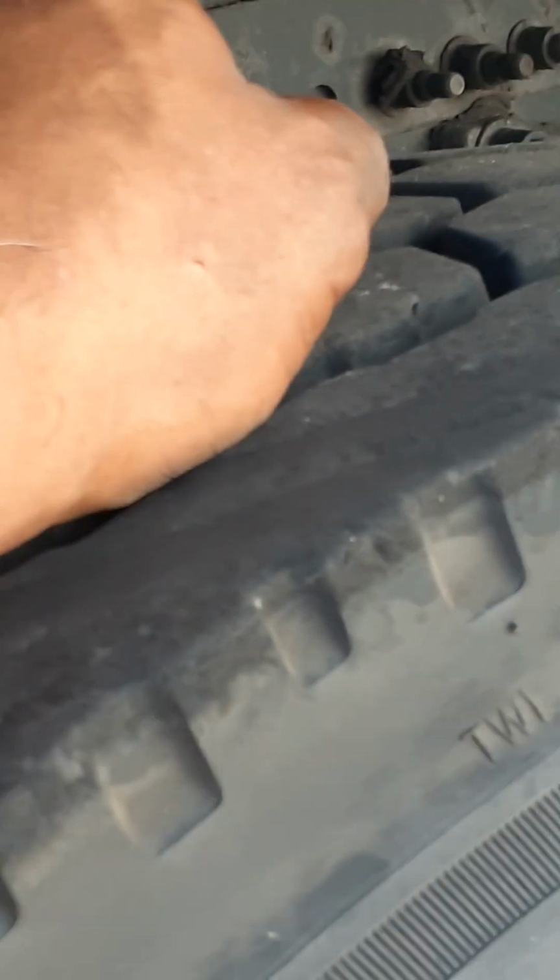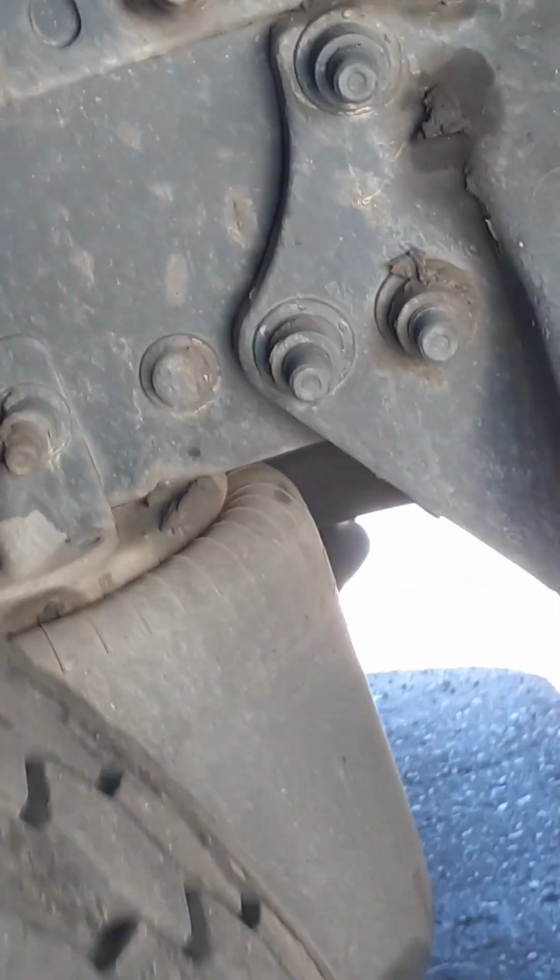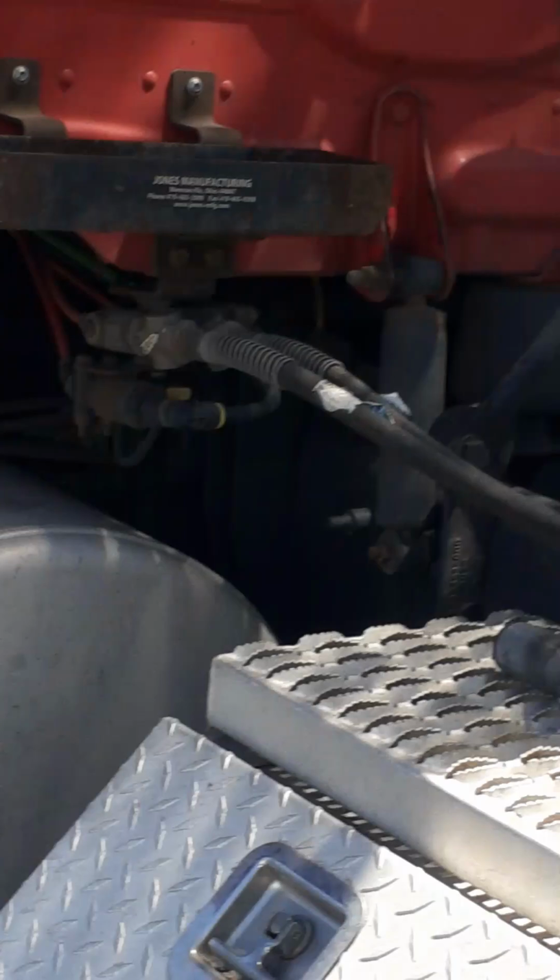The only thing we spray, because it goes all the way back here, is to make sure that nobody got a knife and went like this and cut your lines. We see this at truck stops when they pull your fifth wheel pin. And here is your pin that they pull right here. This usually happens when you block another trucker behind you, or you got into some type of beef with another truck. And other ones will go right here and slowly slice your lines a little right there to make you lose air brakes. So pay attention to all of that. That's why we cover all of this, and we make sure that there's a cover so that no one goes right here and slices it.